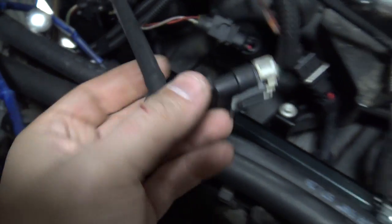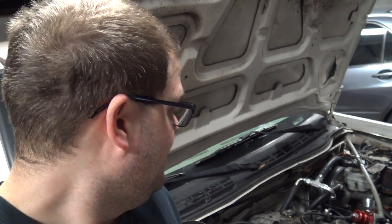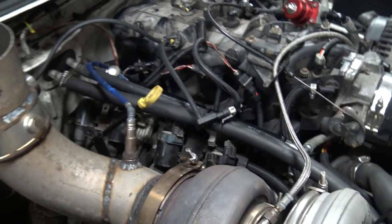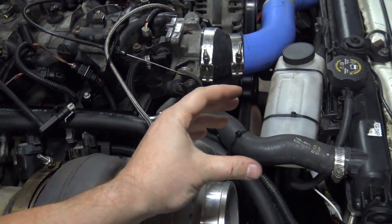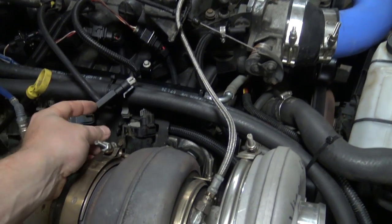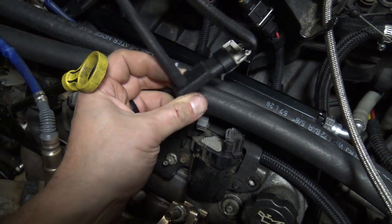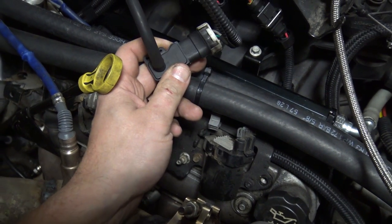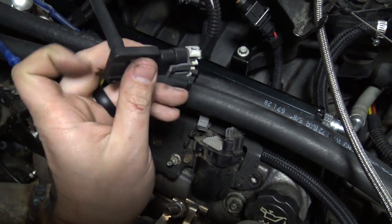What happened is, this is like a potted laminate cover here. It's like putting your headlight in an oven and it melts the glue. All this glue melted out, and after it started being funny - like we were adding a lot of boost and I would check and see like 8 pounds in the car, and it would sound stupid and run funny. We hooked up my pressure regulator to the map sensor directly, and we heard it hissing. We thought it was the hose being too big, but no - the air was coming out of the map sensor itself. It delaminated. The map sensor was relieving boost, so there was more boost in the intake and the sensor just wasn't seeing it because it was blowing out the sides. So we had no clue how much boost it was actually running.